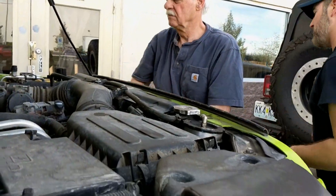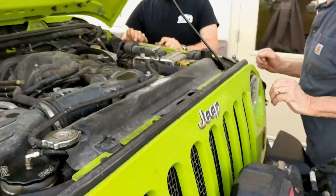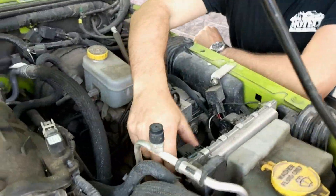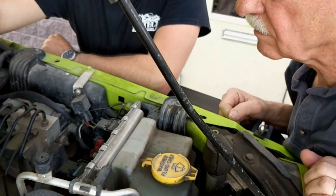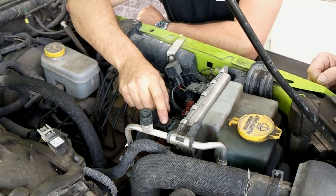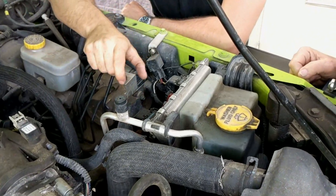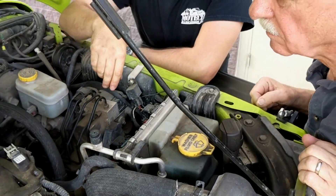You've got plenty of space over here. Your computer mount uses these two right here. This harness is your engine harness — you'll unplug all this. This connector is included with the electrical package. You just connect it here; it has a little 5-pin connector that attaches to the GM engine harness. And you're done there.